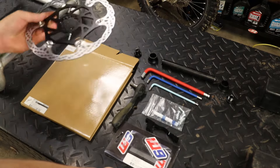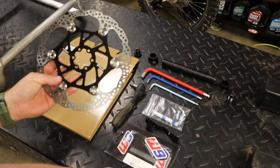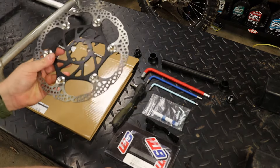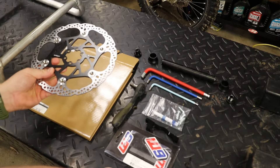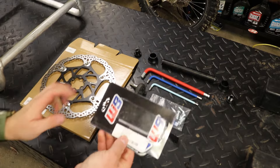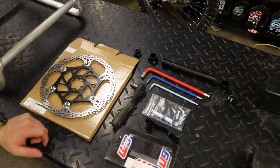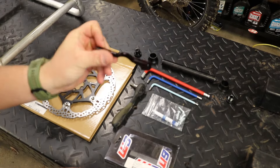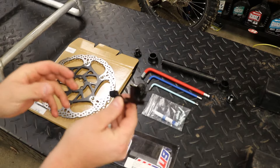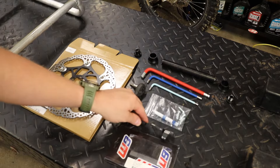We have everything here we need. This is the Warp 9 S-FR220-F front rotor. You can type that number in the AOMC search bar or you can just check the link in the description. You also need the front brake rotor adapter S-FB220 — link's also in the description. Your stock caliper is going to bolt to this adapter, and it moves your caliper back a little bit to allow room for the bigger rotor.